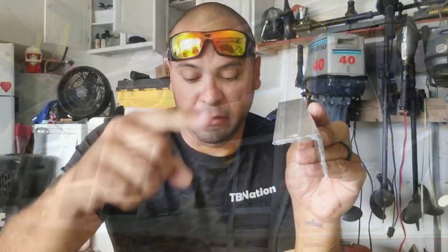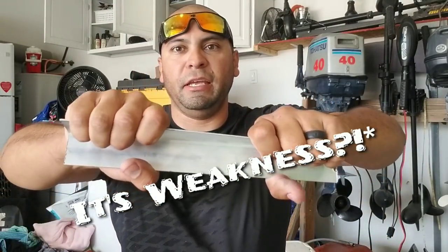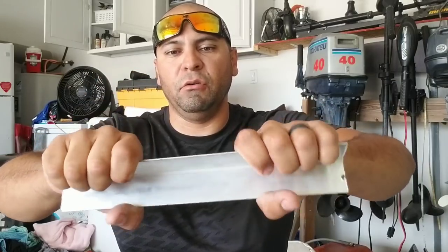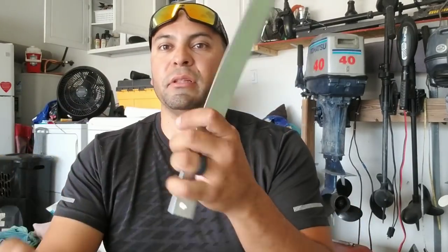I've since switched only to 1/16th angle - 1/16th by 1.5 inch. I like 1.5 because it gives you a lip so your hatch can sit on it comfortably. You can go one inch and it'll be even lighter - I use one inch in my yak killer because in a boat that small it really matters. The weakness is it will flex - even at a one-foot span you can see I can bend it. So you do need a lot of under supports per span. I generally use 3/4-inch by 1/16th tubing for spanning because it's really unbendable in those short sections.